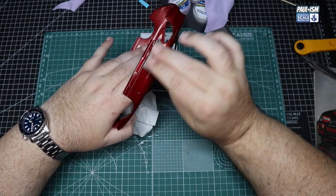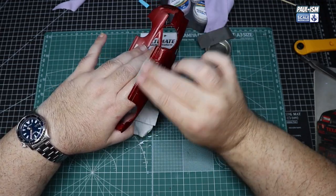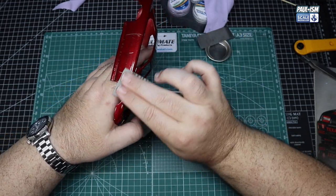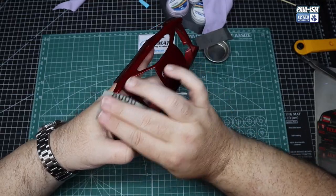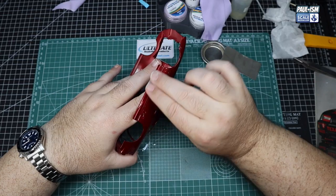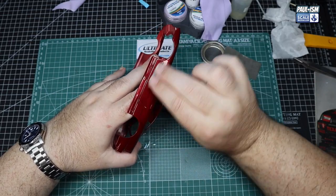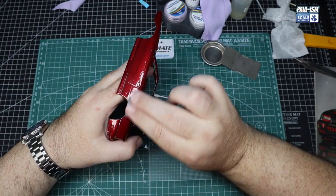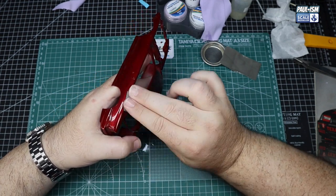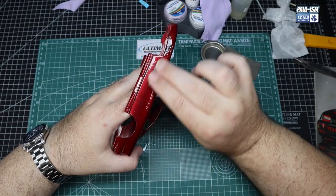And you need to be very aware of any raised areas like the edges, wheel arches, door handles. Don't go too heavy. I'm applying no real pressure here at all. We're keeping it wet with nice clean water and just constantly going over it with very, very fine pressure. After you use the 8000 grit, I've moved to 12000. And we're going to get rid of a lot of those maybe micro scratches we've got and try and get back the best finish we can.